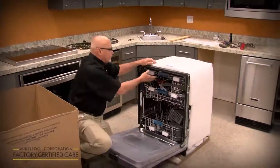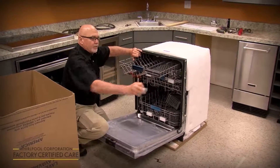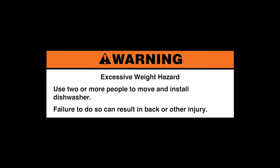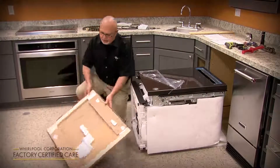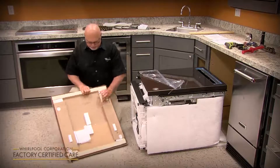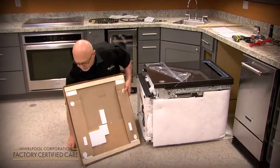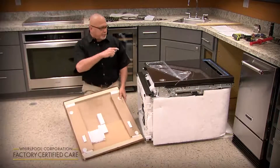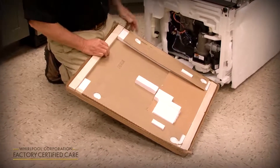Open up and remove all the styrofoam pieces on the racks. You can go ahead and tilt it on its back and remove the shipping base. Again, you might want to save the two strips of wood in the shipping base in case you need to use them as shims for the cabinet, or if there's a built-up floor, you can use them as runners to even out the floor.